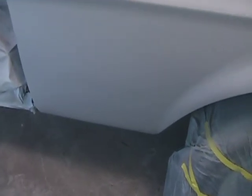That stuff sprayed good. It came out of the gun good. Actually, I turned the pressure back down to about 29, 30. It does look better. Doesn't look as bad as it did yesterday, bodywork wise. Some little dimples on that line there that I've got to take care of. I still see that mark there a little, so I need to sand it out a little more or fill it or something. I can't touch it right now, so those dents, obviously I've got to take care of those.